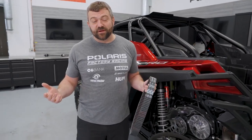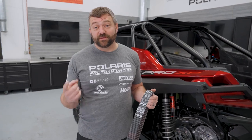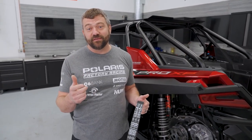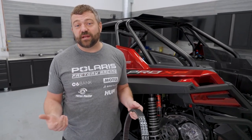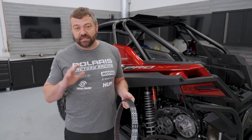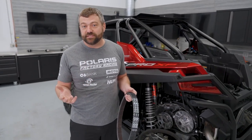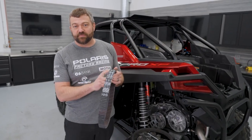What are some of the things that destroy belts real fast? The first one is not using low gear when you need it. When you've bought a brand new Razor and want to load it on your trailer, the best thing you can do is shift into low, put it in all-wheel drive, and get into the throttle enough to get the wheels rolling. Where a lot of people go wrong is they treat it like their truck that's got a torque converter - they ease into the throttle thinking they're taking it easy, but you're actually tending to hourglass or spin burn the belt.